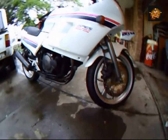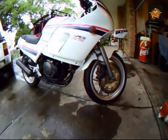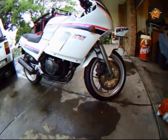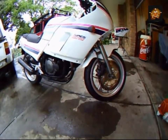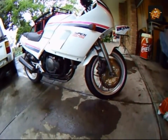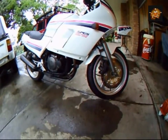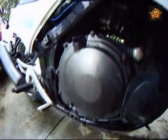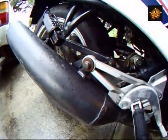Alright, it's washed. Pulled the front wheel off — axle was fine, still silver, had grease on it. Bearings turned with my finger. It's got to be the brake caliper not releasing. Gave it a good clean while I was there — probably came up a hell of a lot better. But it's not my bike, and I'm sure he will fuss over it a lot more than me.